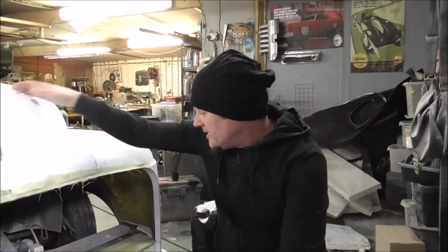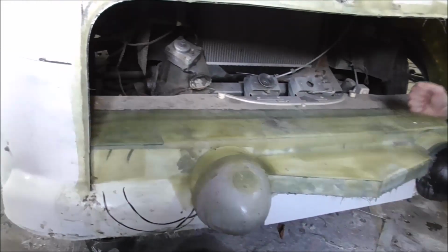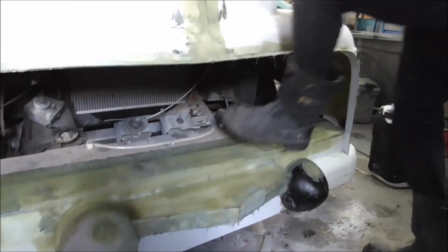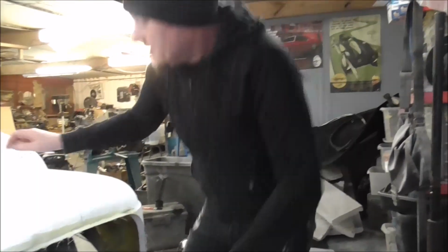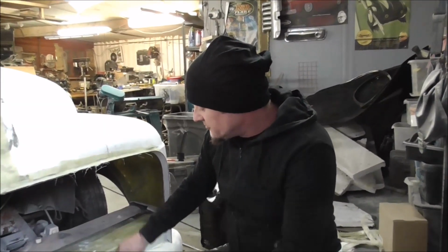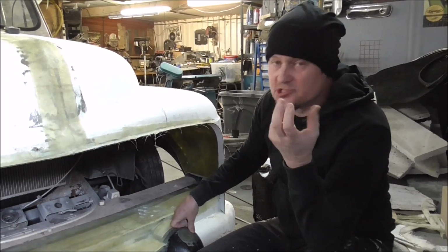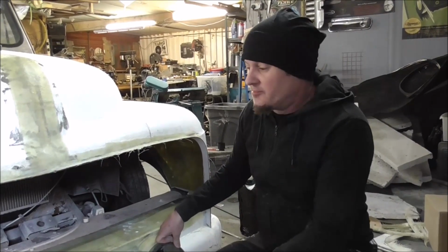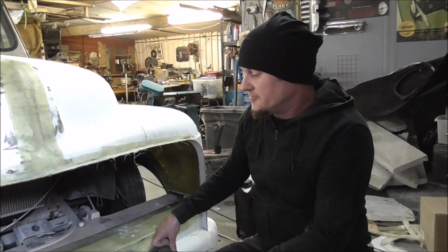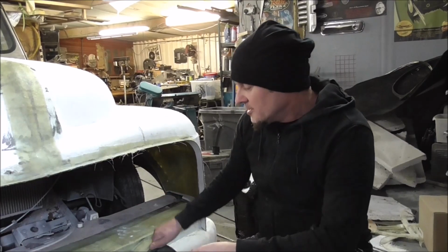Okay, so last night what I did, I fiberglassed all of this together. So this is now super strong. And this is good enough to be a bumper now. Whereas before, like I say, you can just super glue bits of die bond together forever, but it will just fall to bits if you don't fiberglass over it. So just use that as your former, fiberglass over it, all looking good.